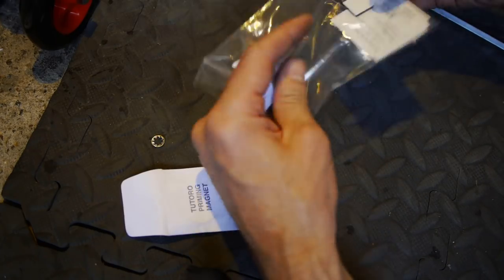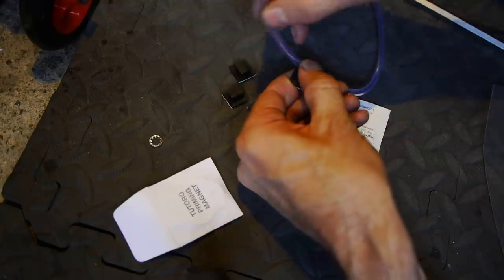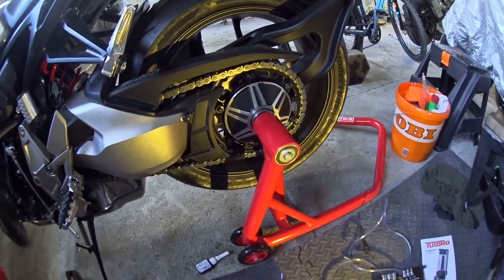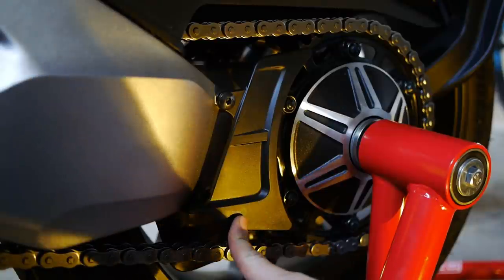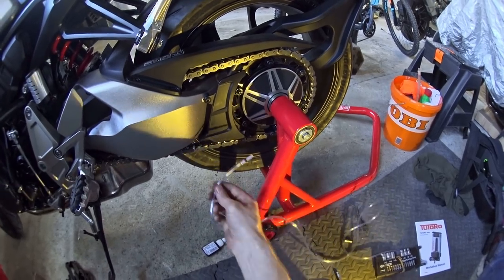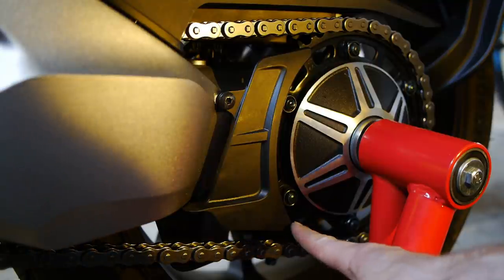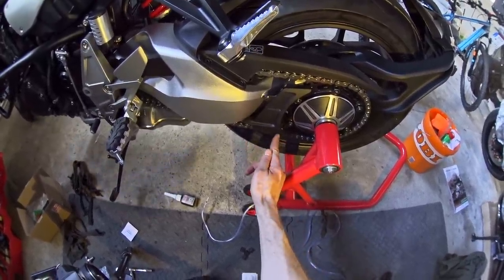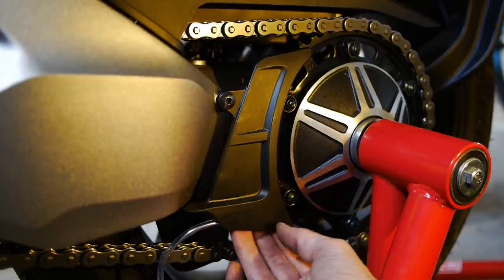In the little hose clamp kit we've got four sticky-back clamp pieces we can use to run the hose along. We could also use one as a basis point with the hose fixed in that, and then angle it to wherever we need. Here at the back of the swing arm just before the sprocket there's actually a shark fin or toe guard, which is there to protect you from accidentally stuffing your toe between the chain and sprocket. This can also provide a handy mounting position for our little feed hose. But since there's nothing to mount it on, against my better judgment with a brand-new bike, I need to drill a couple of little holes in this just so I have some mounting positions through which to use cable ties and fix the hose onto the shark fin piece.